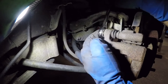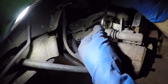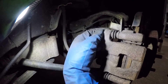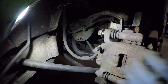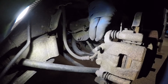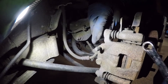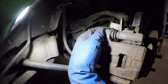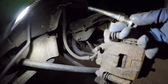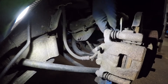So I'm gonna have to turn turn turn here. This is the one thing I don't like about the Nissan system because the whole thing has to turn — usually if it gets jammed you can't even remove this little bolt here. There you have it. Let's put that sliding pin to the side. Now I'm gonna go get my number 19s.